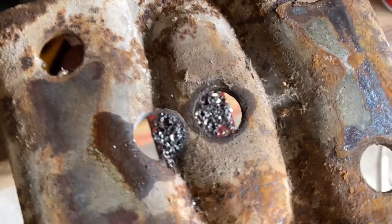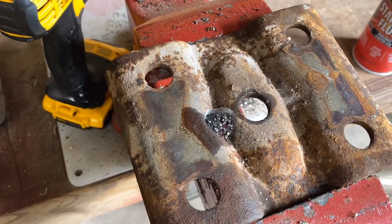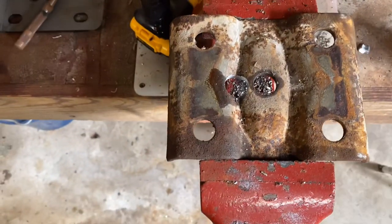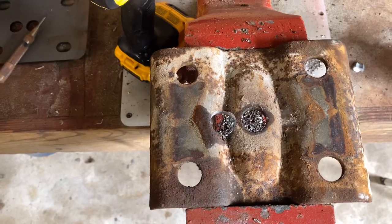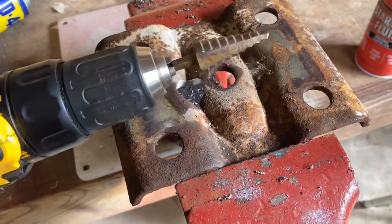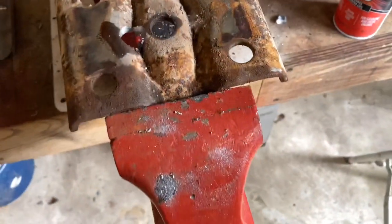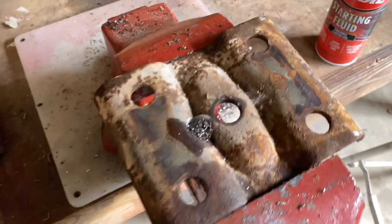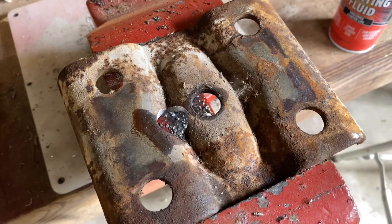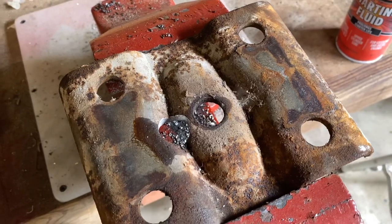So there you can see, just locate the hole a little further forward. And when you install it, it sits on the leaves at the right angle. It's the top notch, which is 3/4. So you got yourselves a 3/4 inch drill bit. Chuck that up in your drill and full send, and the perch should fit on there good for you guys.